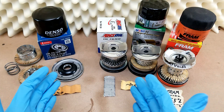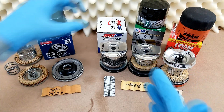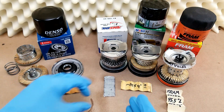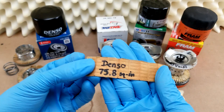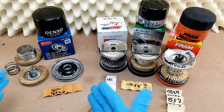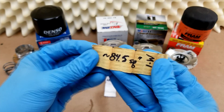If you Google around, you'll find forums where guys discuss potential quality discrepancies between Denso filters and their country of origin, so if you want to go down that rabbit hole, go ahead. But even if this Amsoil number of 51% efficient is accurate for this Denso filter, it wouldn't really surprise me, because that's a 20 micron test and fully synthetic media performs well for those tiny particle sizes. This is probably a cellulose or synthetic blend, and they don't usually do as well down at that level. If you were to put the Denso filter through a 30 micron test, you'd probably get somewhere in the 90s — look at the Mobil One box: they advertise 99-plus percent efficiency, but they're doing a 30 micron test.